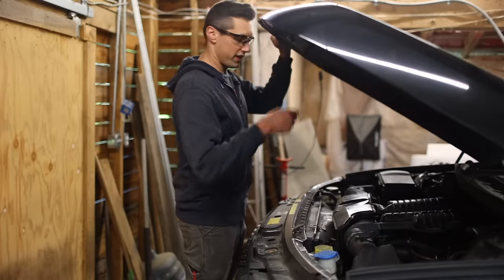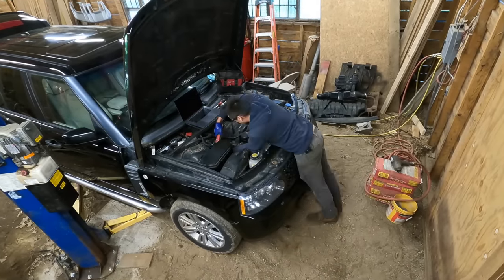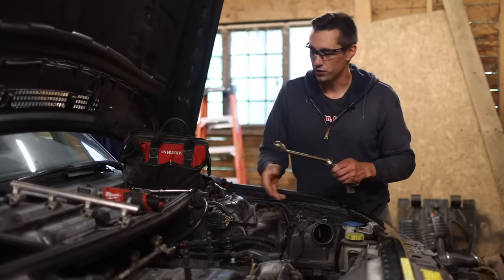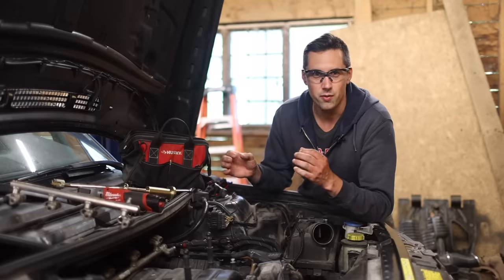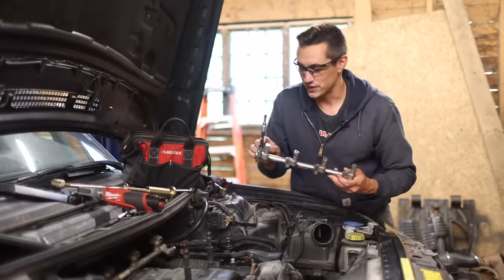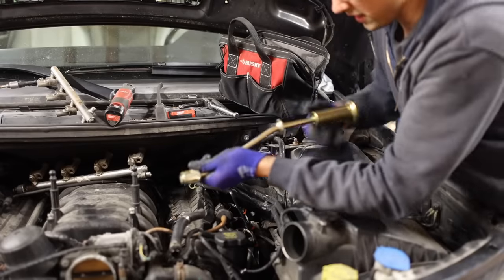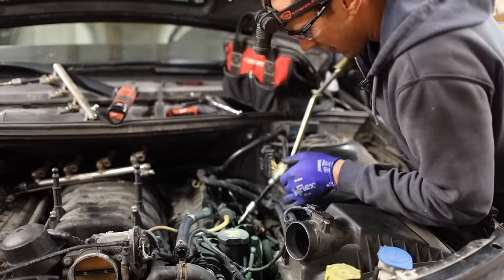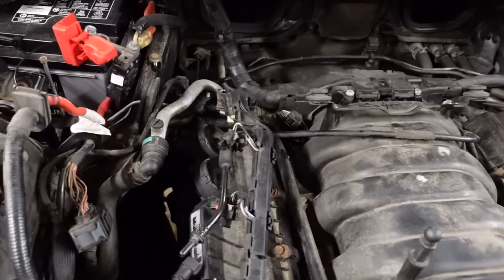The first thing I need to do is remove a bunch of stuff to gain access. I'm at the first point where I need a special tool — this slide hammer — to get the fuel injectors out. These can be pretty difficult to remove, so I opted to do this first while the engine is still warm. While the cylinder head is hot the holes are larger, and look at the results — one of the fuel injectors actually came out with the fuel rail, and it's the one all the way in the back, the hardest to get to. I stick the collet over the fuel injector, lock it, and pull it out with the slide hammer. I got all eight injectors out and had to remove the cabin air intake to access the back injectors.